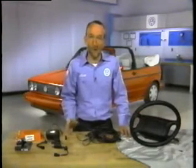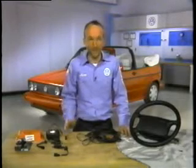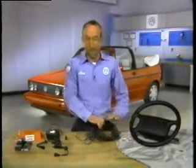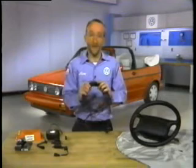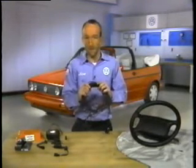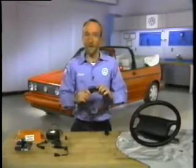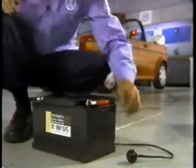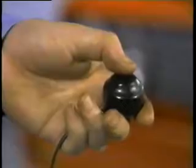Now, don't attempt to do this by mounting the airbag unit in any special fixtures or by laying it on the floor. Also, a special harness must be used to activate the airbag. This harness is 30 feet long. One end gets connected to the spiral spring. The other end is connected to a separate battery that is placed 30 feet away. The airbag can then be activated. The complete procedure can be found in the repair manual microfiche.